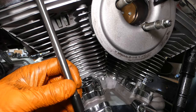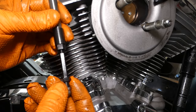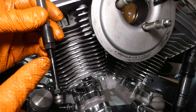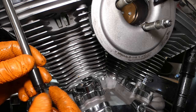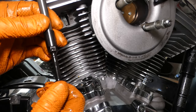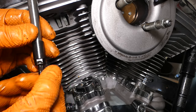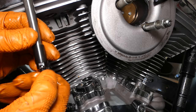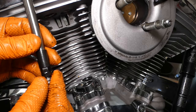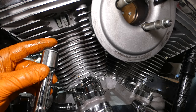In order to do this, we're taking our push rod and undoing this adjustment here. I'm going to spin it out, put a little bit of oil on these threads, and then spin it all the way in. We're going to collapse this thing all the way. See how this slides all the way in? You've got the nut here — it's all the way in. Make sure you've got the top facing up, side with the collar goes up. Slide the push rod in.